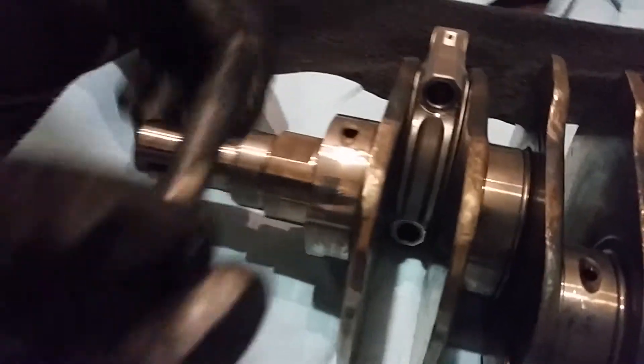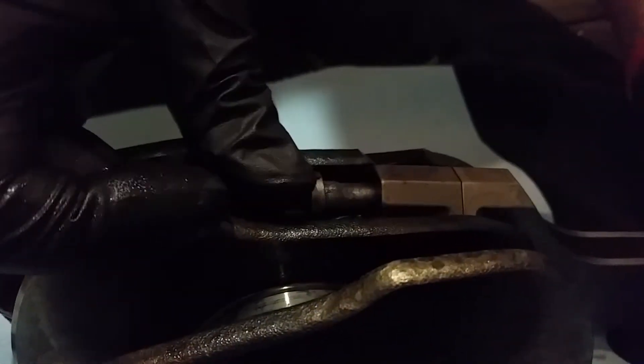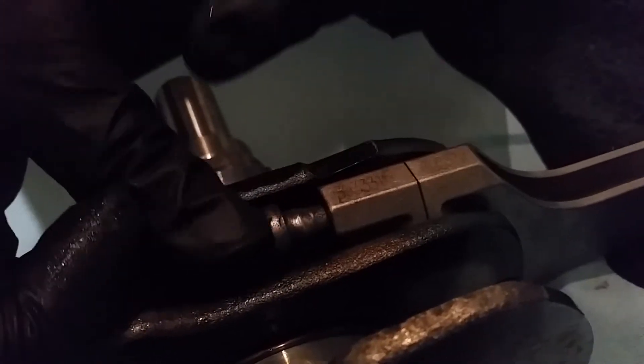Take one of the bolts and put it right through the top there. Make sure you have your ultra torque lubricant on it as well — very important. Get it on the top of the rod bolts and on the caps where the bolt surface is going to connect. In this particular circumstance with the ARP2000 bolts, we will be torquing them to 10 foot-pounds each evenly, and then to 45 foot-pounds in one full pull. We'll cover that in the next video.